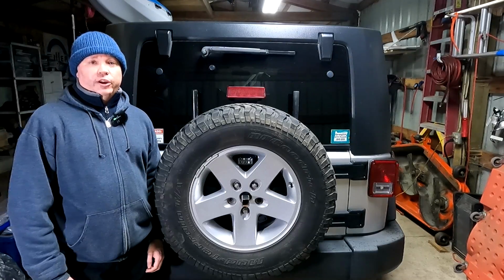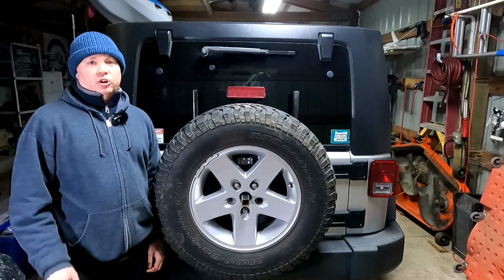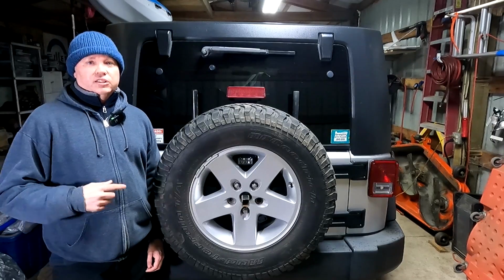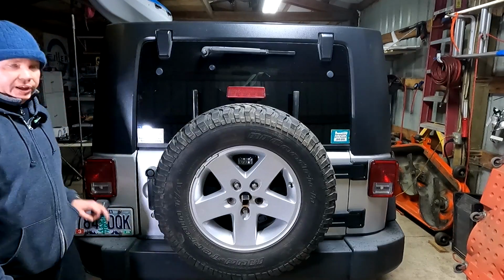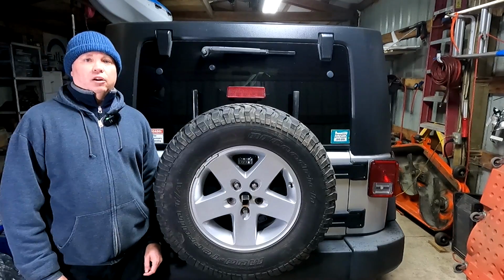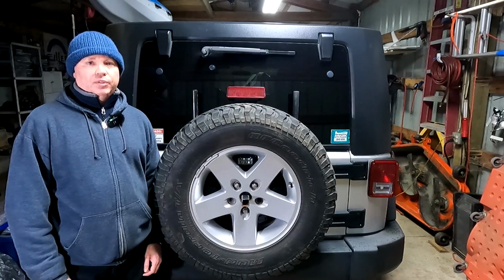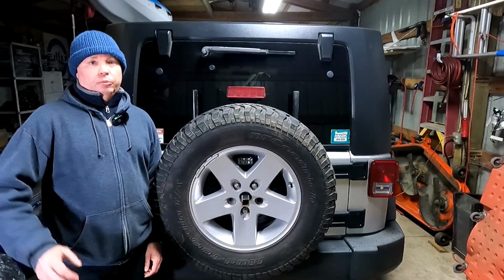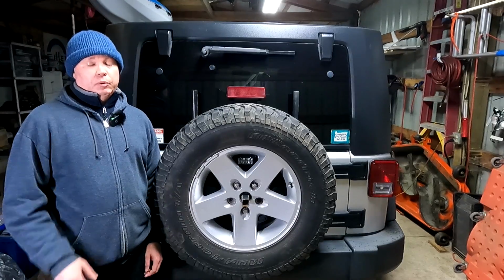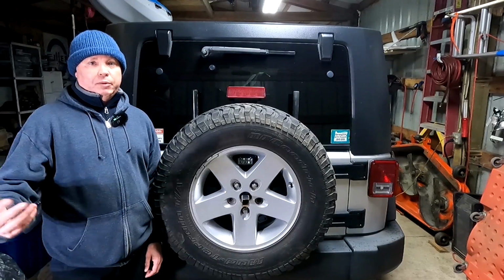Well, the fog and the rain started to roll in, and my nighttime video quality isn't that great, but hopefully it was good enough for you to tell that taking out the old 3157 incandescent bulbs from the backup lamps here and replacing those with the all LED lights helped a lot with the nighttime visibility. And then adding the 4-inch LED pod light from Nightlight, that helped quite a bit as well. But without being so bright that it ends up potentially blinding someone that may be behind me.